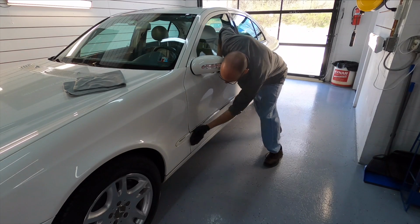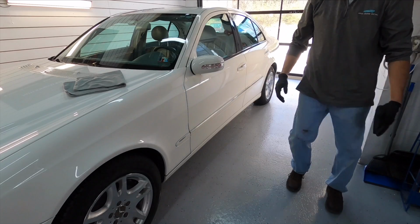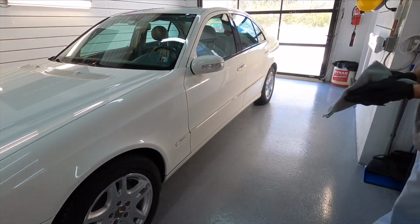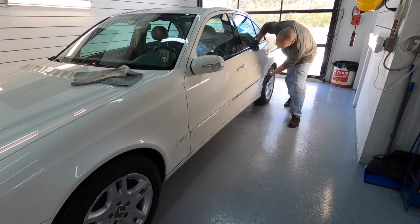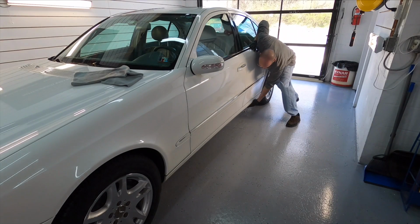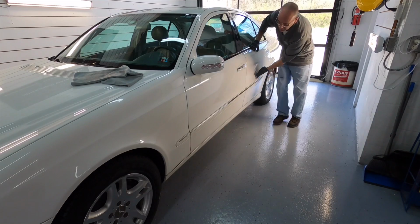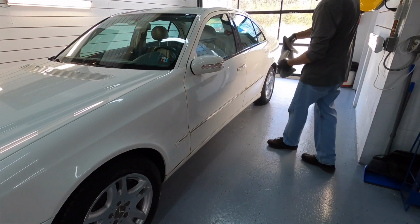There's some lubrication there, but I would definitely rinse that synthetic clay after every panel, or it will start to really get grabby as you move on. Also, when you're finished, even if you have rinsed it thoroughly, you definitely want to store it with the synthetic clay part up. It will grab onto and bond to anything that it falls against and leans against.